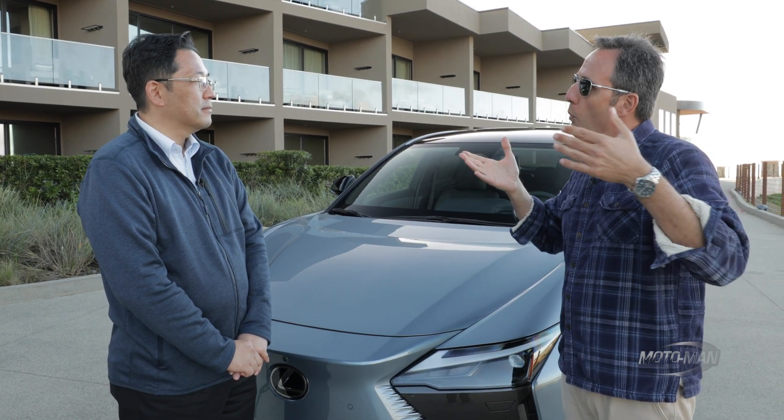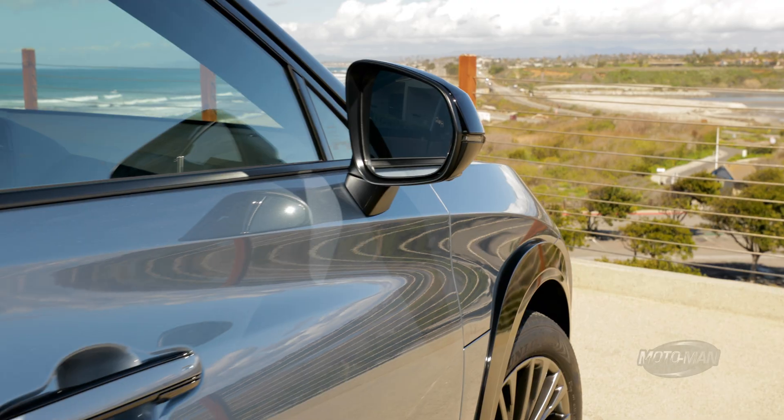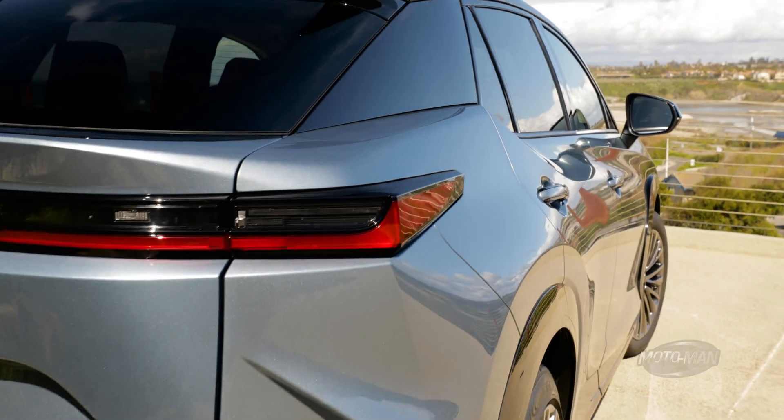With this fancy steering system, why wouldn't you have added four-wheel steering? Four-wheel steering would add more complexity and components to the rear axle — more additional parts, more control, additional ECU, and so on. When thinking about the price range of this vehicle, a car like the LC is high up and people want those devices to elevate their driving experience. But this market, especially around this BEV SUV segment, is very price conscious. So we wanted to reduce cost as much as possible, and not adding rear-wheel steer also reduces and minimizes weight, which extends the range as much as possible.